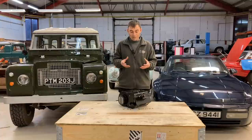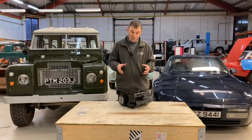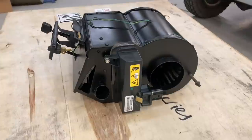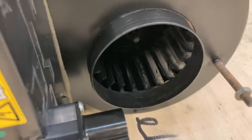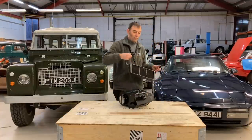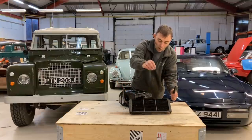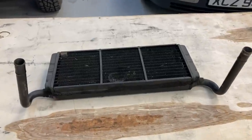We have to start with something like this — for those that know, this is a Mini heater box. You've got your fan, selector, and heat controls. Essentially, all it is is a fan with a blower and an element inside, getting hot water in from the engine — like a radiator — and the water goes through and comes back out. You'll have hot water coming in, going through, and then back out, and you blow the air through that to heat it up and send it into the cabin.